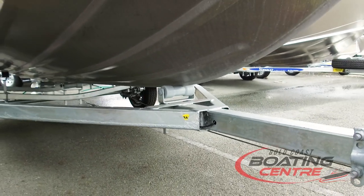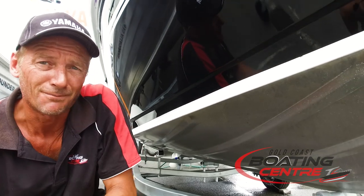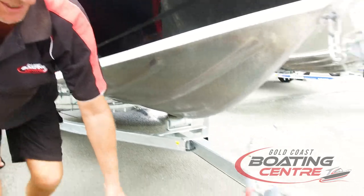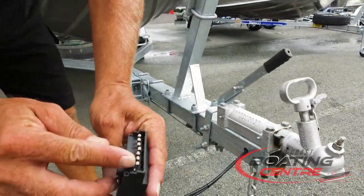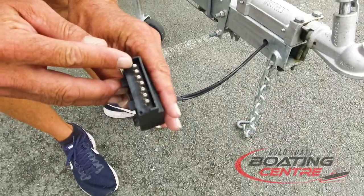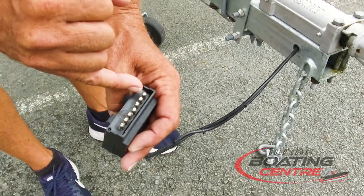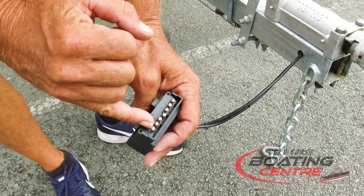The trailer lights are LED, so they're fully sealed and waterproof. If you ever have problems with a brake light or an indicator, come up to the pin end first. You'll notice there are seven pins, and each one has a slight slit inside it. You'll notice that one may be slightly compressed over. If you lose a brake light or an indicator, start here — just take a Stanley knife and open it up so they all look even.